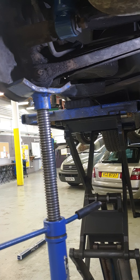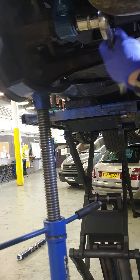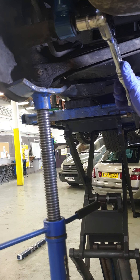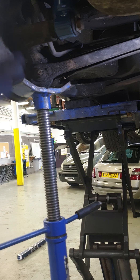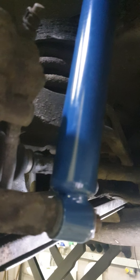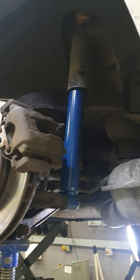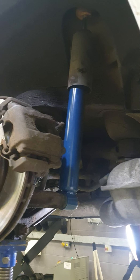There's no chance of getting an air gun in there, so use a ratchet instead. This bolt needs to be torqued to 38 Newton meters — tighten it hand tight, then use a torque wrench to finish. The bottom bolt is in nicely and all the parts at the top are replaced — and that's how you replace a rear shock. Any questions, drop them below. Hope you've enjoyed this video and that it helps you in your automotive journey. Please like and subscribe — thank you very much.